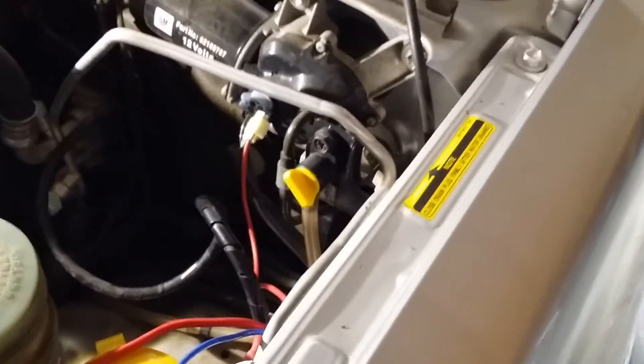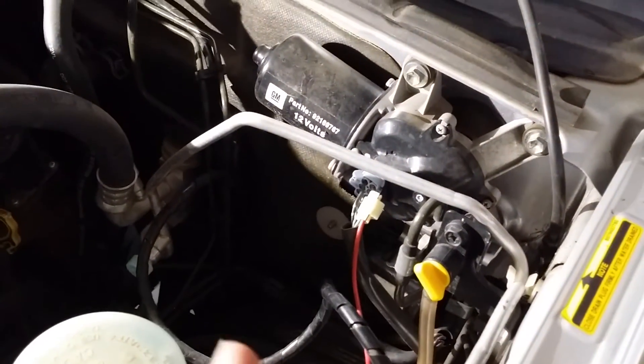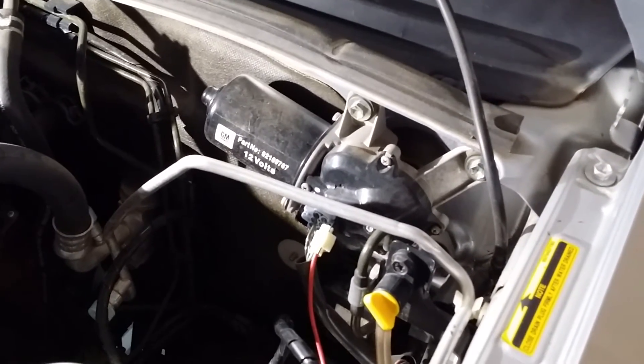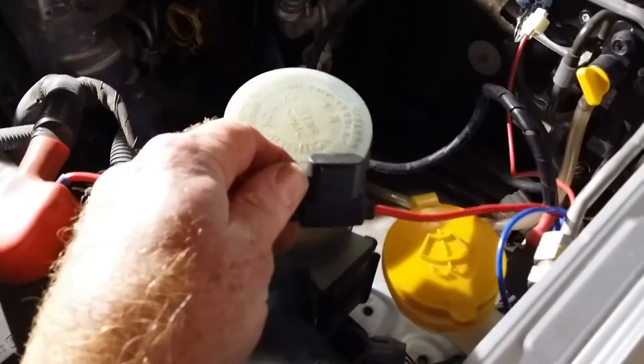It's simple. Just keep away from the electronic side of your car and go into a non-vital part like the wiper motor. If you get a cross circuit or wires rub through for some reason and it comes back to your wiper motor, it's only going to blow the fuse and it's not going to fry your computer. Make sure you put your fuse to your battery and you'll be laughing.